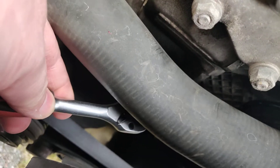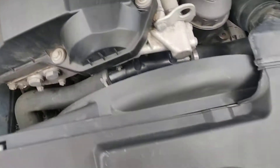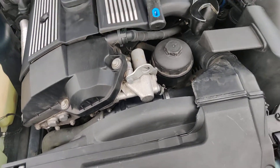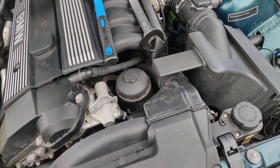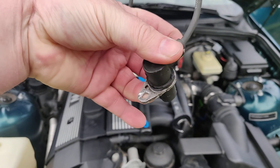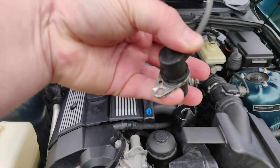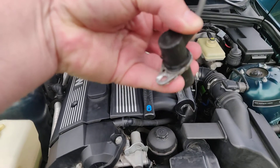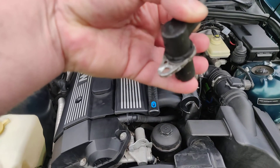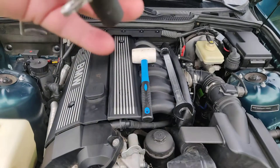This one is quite hot so I don't really want to get too close to it — it's in here. If your sensor is not stuck at all, it's placed like this with a metal bracket, an aluminium bracket that's part of the engine block around this bottom edge. It sticks out in the free air on the bottom. If you're not stuck, then that's all it takes to get this out.